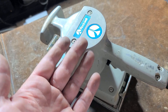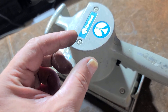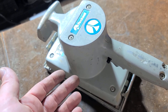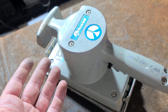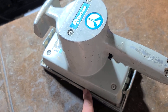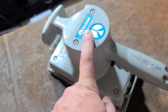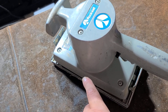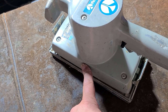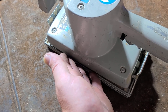If you want to be especially nice to it, you'll get new brushes — quarter inch square brushes — and you can get ones that are like three quarter inch long. They have pretty deep brush holders. Triggers basically last forever. If you want to also replace the ball bearings, you'd want a special HNBR sealed one at the bottom. You can do rubber sealed on the other two — that's a 608 skateboard wheel bearing at the top of the motor, a 6201 bearing in the middle section, and a 6202 bearing for the plate section at the bottom.